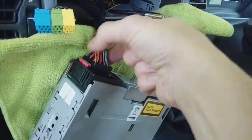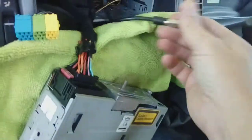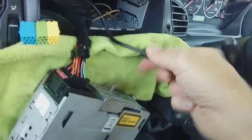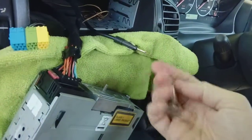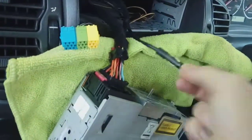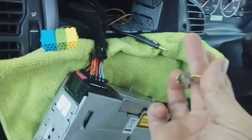We'll only be having one power feed, which is actually built into the block — nice and simple wiring. We've pulled our aerial connector off. It's just a pull fit and it comes with an adapter on the end. Pull the adapter off and that's your normal bayonet fit, which will fit 99% of the aftermarket radios that you can buy. Put that to one side, you don't really need it.